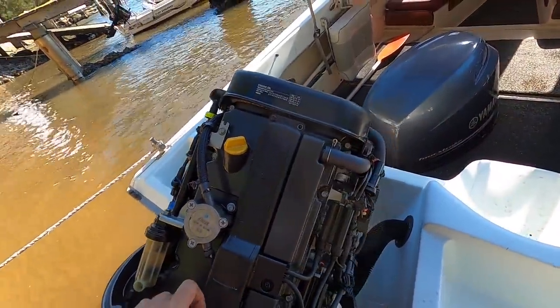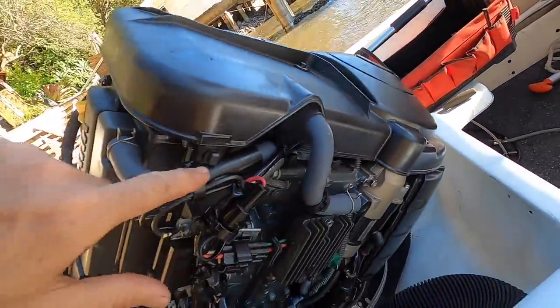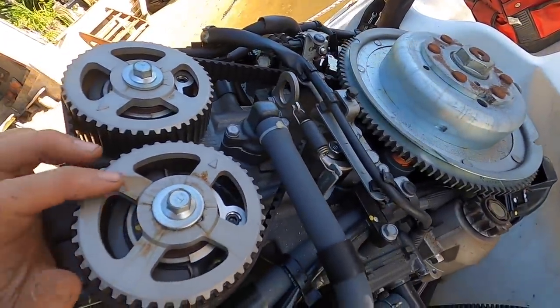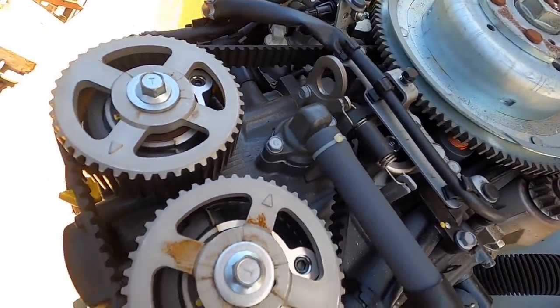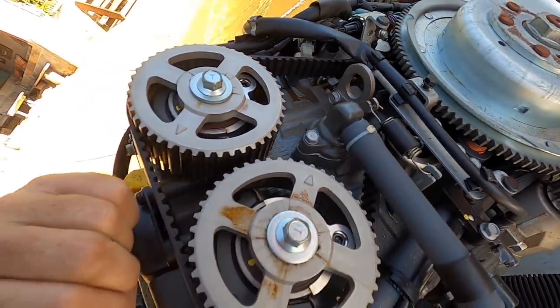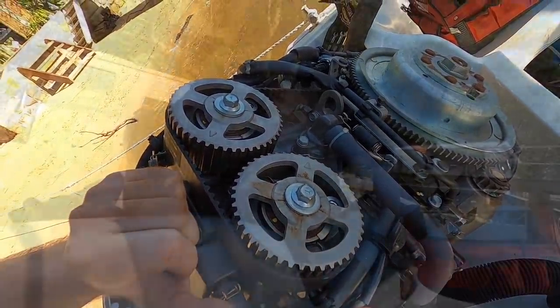Always have a good look before you start reaching for the tools. Alright, let's start at the beginning and start stripping down to see what we see. Looks like a 10mm nut at the top and then just these rubber catchers. Off. Pretty standard sort of outboard timing belt tensioner and we've got some marks. We could probably rotate it till it all lines up to make reassembly slightly easier. Let's do that.